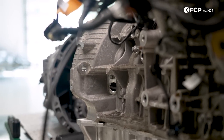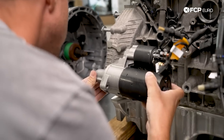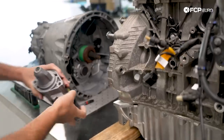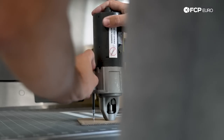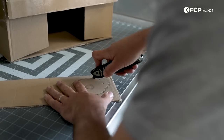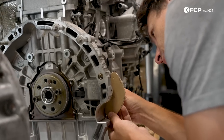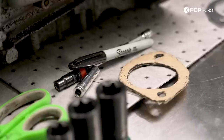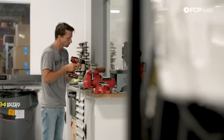This will definitely make changing the crank position sensor a little more difficult — an extra step of removing the starter motor every time you need to do that. We'll leave it something like this until we know that hole, but obviously everything below that is going to need to be cut out. What I'm going to do here is take this front flange and make a cardboard template of it so I can hold it over here and see exactly what it looks like. It's going to be close, but we should have enough room. Nate had to precisely measure and cut into the engine block to position the starter perfectly to engage with the flywheel.